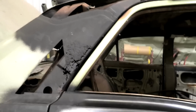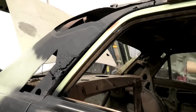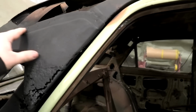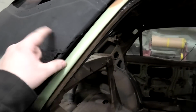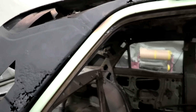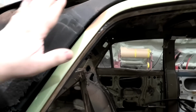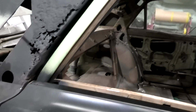Oh, and you might notice that I've actually put the top on this quarter panel. I saved it off the XY. I mean, it's all looking a bit, what are you doing, Graham? But there is a method to my madness. Because that's such a funky shape there, I needed to actually put the top back on. Obviously, I'm going to go across here and chop the rust off and fix that rust, but at least it gives me the top of the quarter panel, because obviously it was cut through there, and that was all missing. And I know under there is actually pretty good, so it wraps around and whatnot. So that I might do today.